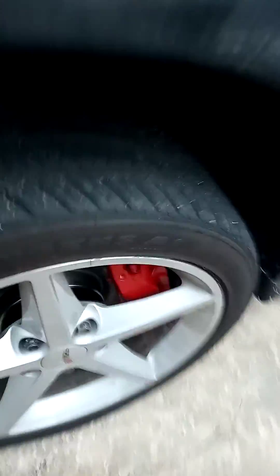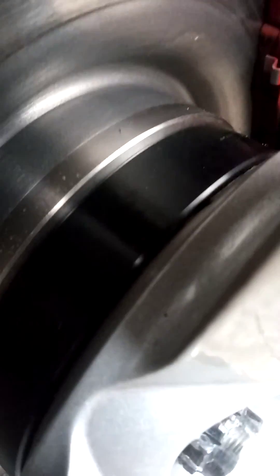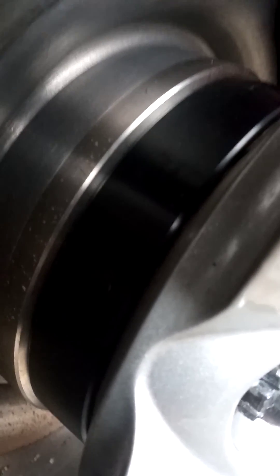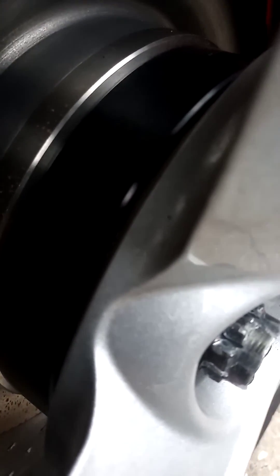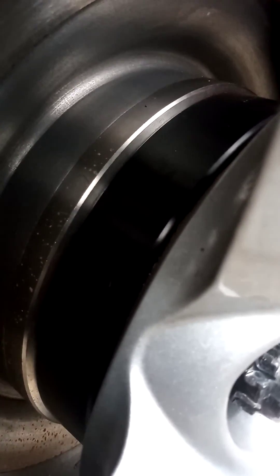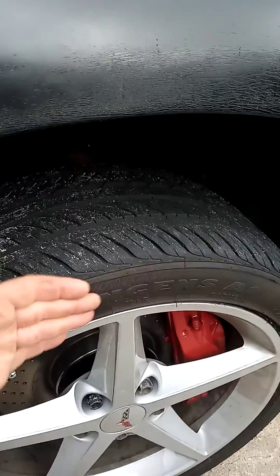People have problems with the Brembos being wider — they run into the spokes on your stock wheels, so you need spacers. But since I'm running Corvette wheels, they have no backspacing; it's just completely flat after the spokes. Unlike the stock Pontiac wheels, they have like a good inch and a half hub on the inside to bring the wheel out. So without these spacers, the wheels had no problem with turning, but they were not flush with the fender.